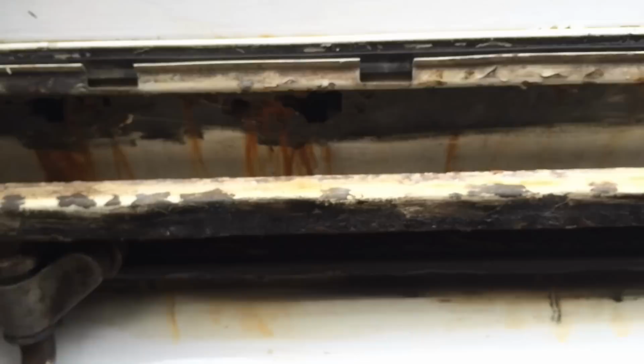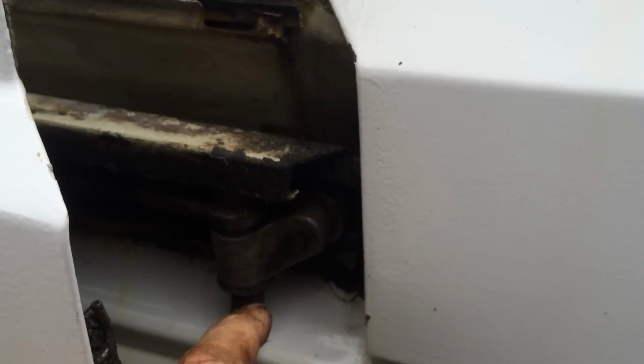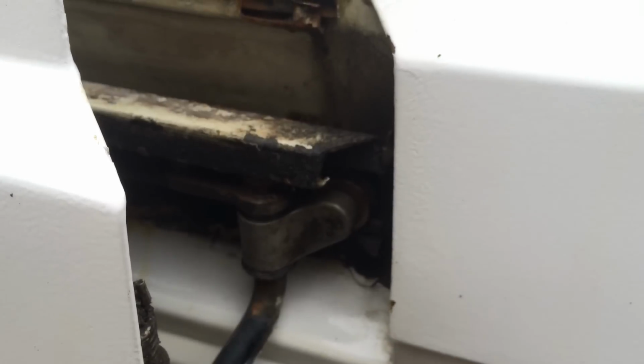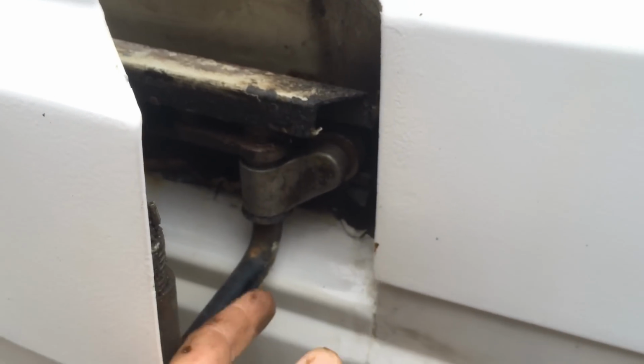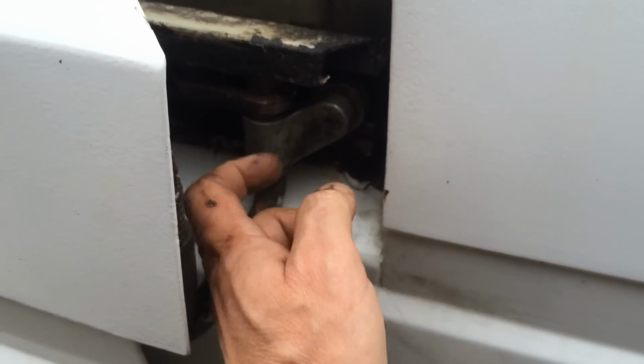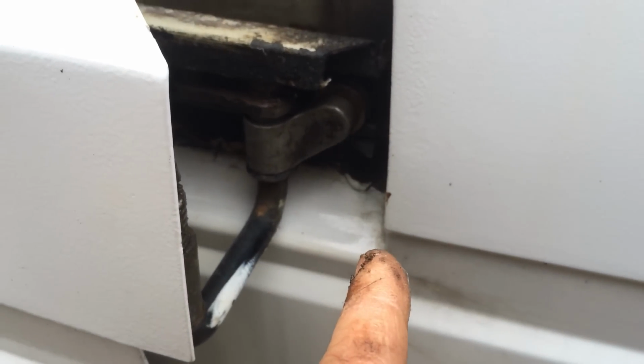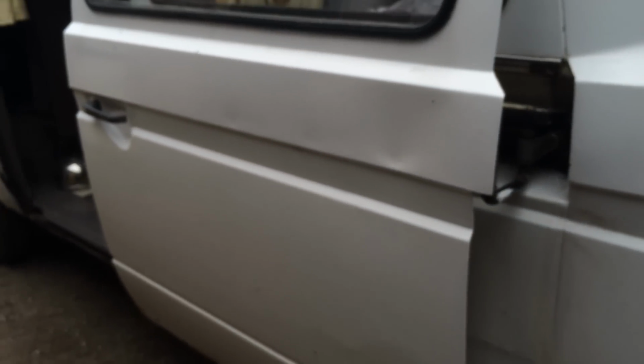Yeah, so there you can see the door slides along the roller to this point here. Come on, expose for the thing. That's it. It's so dark in there. Right. So I'll be sliding that along. This whole roller then turns, so it's coming out like that, and it comes out like that. And then when I do that, the door will be unsuspended at this end, and then I just slide it further, pull the bottom out, drop the top down, and that's the theory. So that's what I'll do next.